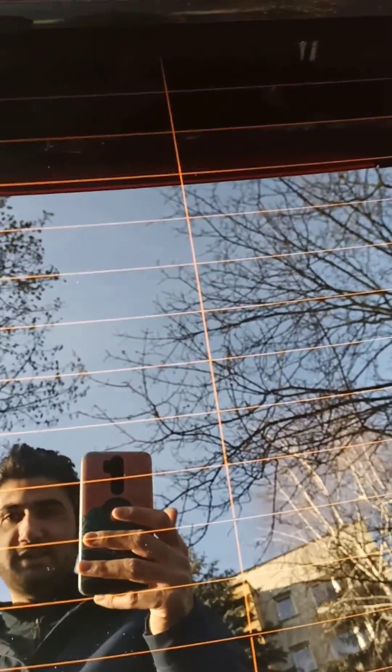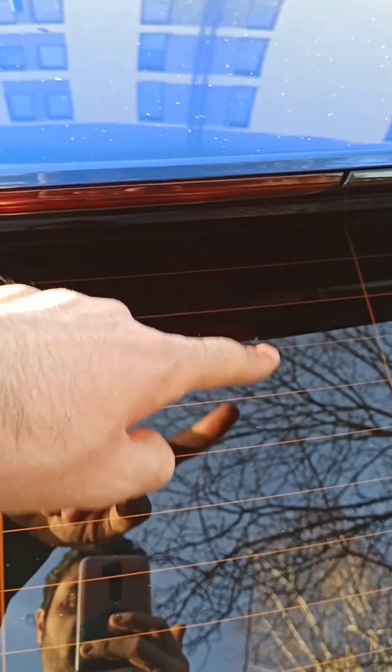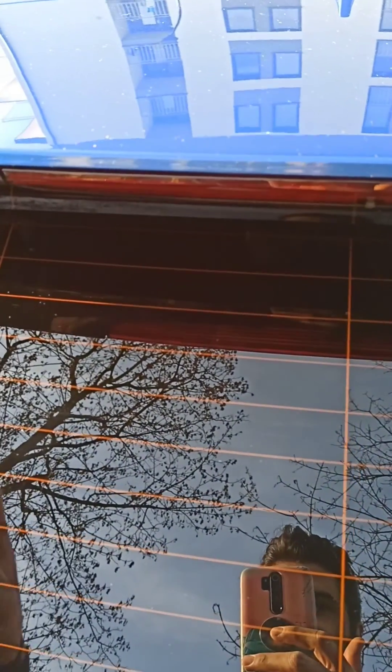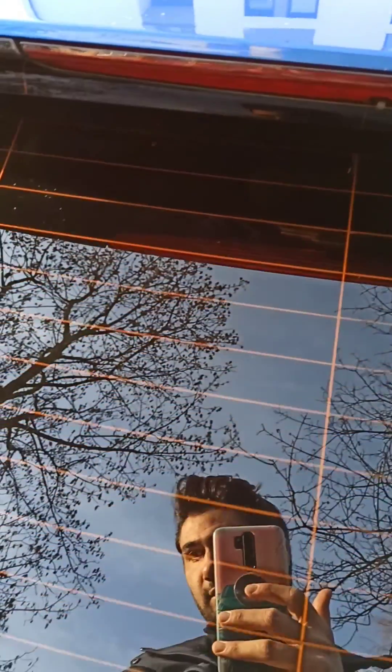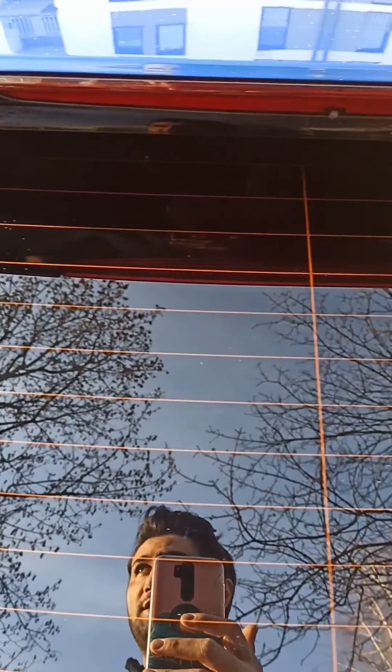In my car I had an issue with the rear wiper, because as you can see it's under the spoiler — there's nothing to grab. So the documentation method didn't help me. What I did instead: when I turned the rear wiper on, it comes out from under the spoiler and moves across. When it reached the middle position, I grabbed it and pushed it up, and after that it stopped wiping — it seemed like it was in replacement mode.